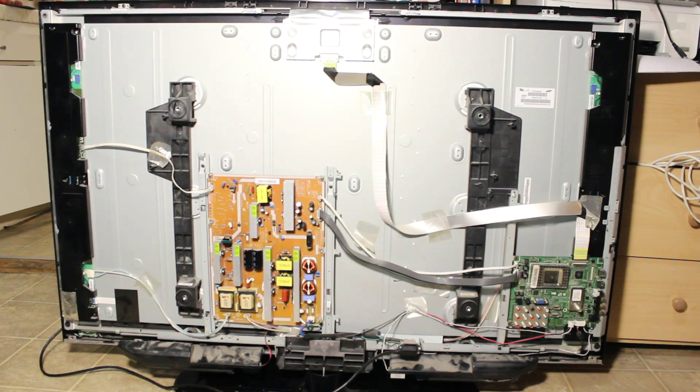So what we're going to do right now is open up the TV, and basically the problem is you just have to swap the mainboard. I've opened up the TV and plugged it in to show you what the clicking sound sounds like — it should be clicking in a few seconds. Okay, so that was basically the relay trying to turn on the set.